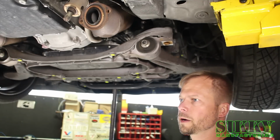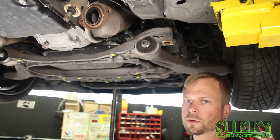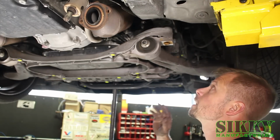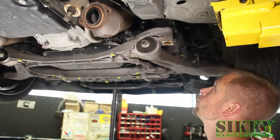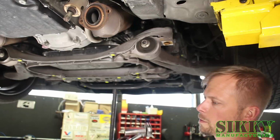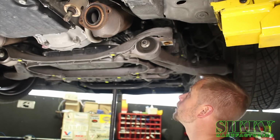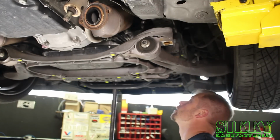So this install is going to require a pretty creative combination of different length extensions, wobble extensions, universal sockets. Just on this particular side, the passenger side, I was able to use an extension and a socket to get all but 2 off. On the back one, it actually worked better just using a 3/8 ratchet and a deep socket to get the back one off. You can barely even see it. And then the last one, it's really difficult, kind of in between 2 of the runners. I'm going to attempt to do the same thing with the socket, so see how that goes.